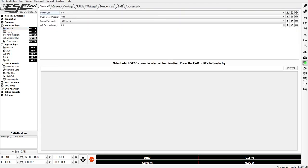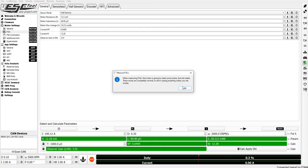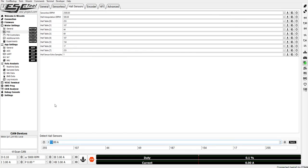The other thing I want to mention is that detection works flawlessly now — I can detect pretty much any motor. It consistently detects within one or two units, which aren't crucial. It does depend on motor temperature, so it's better to detect when the motor is cold. We get consistent values here, and it also detects Hall sensors. We got good results and it works.